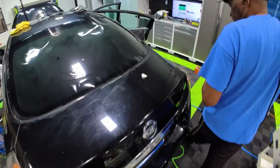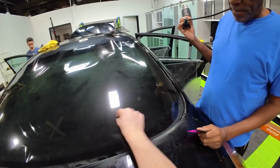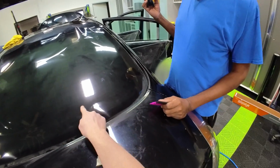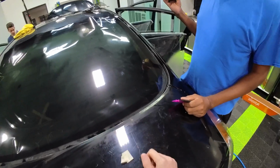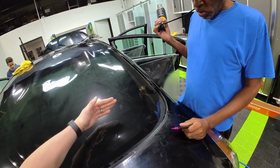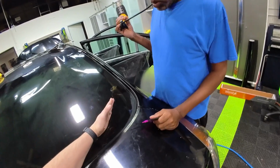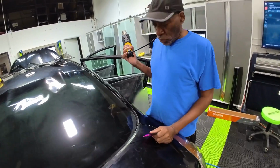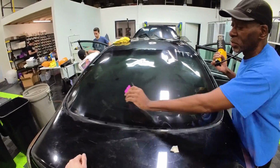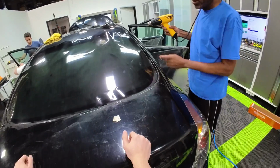But anytime you see the film, you want it to pull this way. You want it to go from being loose to doing those little air pockets that are sideways. The trick is you've got to recognize those, and you're going to push them straight forward, or if they angle, you're going to push them out that way until they completely disappear. Right. Towards where the smile is, you say. Yep. So these ones are going to go in this direction. Exactly. Right.